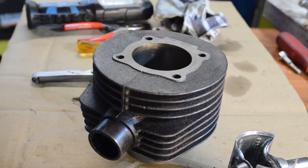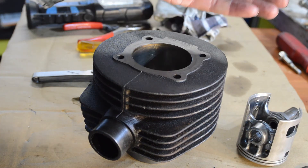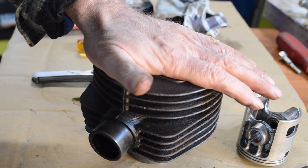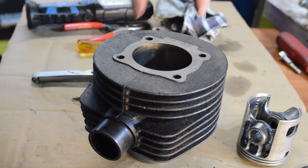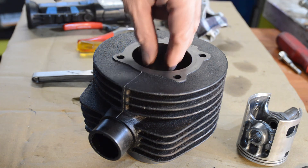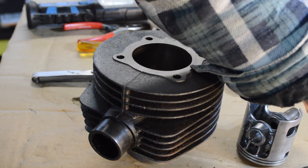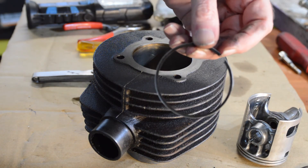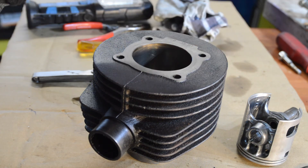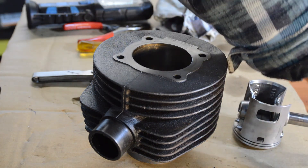I've had a quick look online, and of course this channel isn't called Old Nuts Garage without good reason, because when I said it was only 2,000 I actually meant 0.2mm — which is right for a PX125. I'm assuming that would be the same for the Malossi as I can't find any info on it. The top ring at 0.2mm is fine. The bottom ring at one and a half was a bit tight, so I have filed the edge of the ring slightly and got that to also 0.2mm. It's at the tight end of the acceptable range, but we're okay.